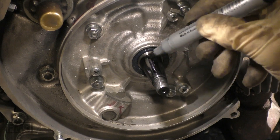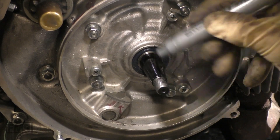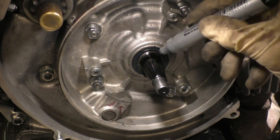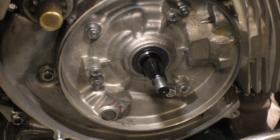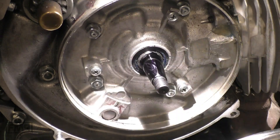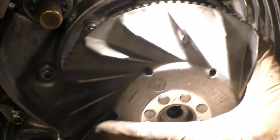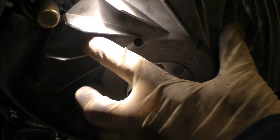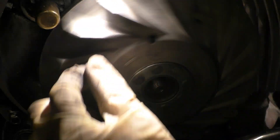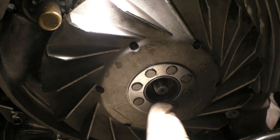This is a 2011 ignition. The test is: just mark it with a pen, then take the flywheel, remove the woodruff key, push it on there, and just turn it. Remove the spark plug so you can hold the piston down and the crank does not move.